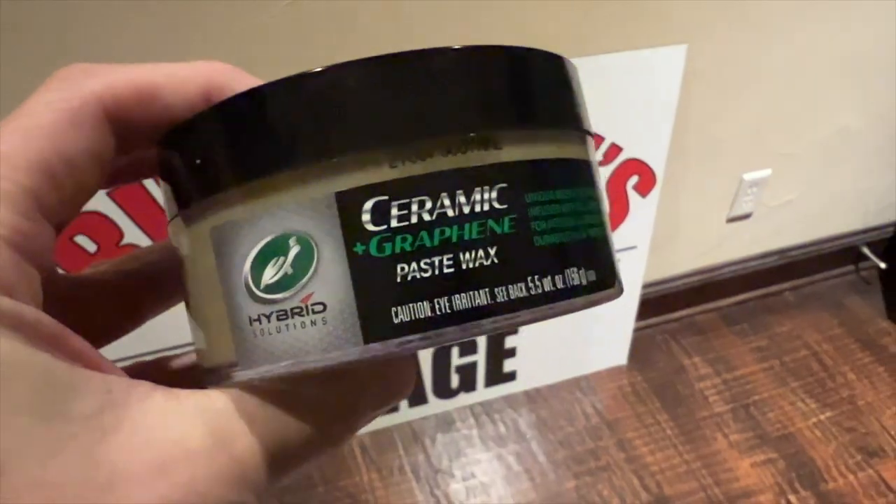We're going to cover machine polishing in the next video, which is the third step in my detailing series. The machine polishing step will use special polishes and pads to remove any marring left from the clay bar process, as well as any scratches or swirls that might be in the paint. The polishing process also helps to level out the clear coat to a flatter surface. Even if you don't plan to use a ceramic coating — maybe you're going to apply a wax or a spray sealant — you're still going to get better results by going through the steps of washing, decontamination, and polishing. I have a couple of different clay bar products here to show you. First is a clay bar that comes with the Chemical Guys Clay Luber Spray Lubricant — this is their OG clay bar, which they claim is a light to medium duty clay, and that's what I'm going to be using on my Goldwing today.